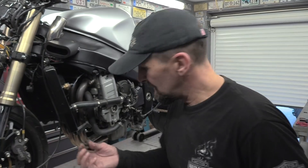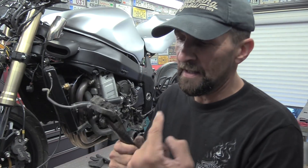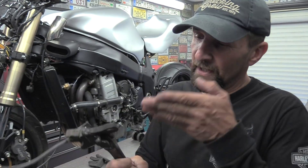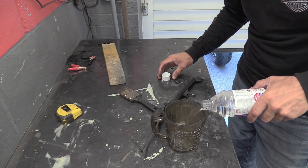This is the sort of thing that gets irritating - a three minute job taking half an hour. Previous owner bodge or whatever - there was a nut on the back of it, which is correct, and then the bolt that holds it on also threads into the back of the stand itself. But somebody not knowing that kept turning and stripped the thread in the back, so that bolt absolutely would not come out. I've had to take the whole assembly off, put it on the bench, cut the end of the bolt off and re-thread it afterwards to repair it. Three minute job, half an hour.